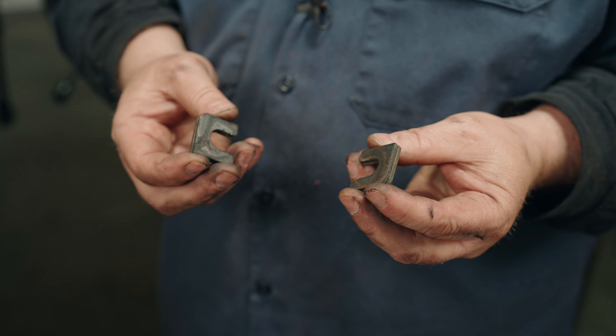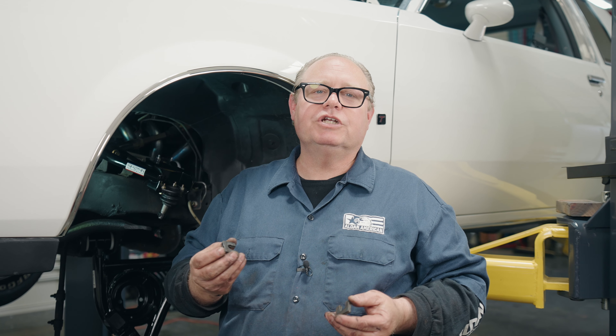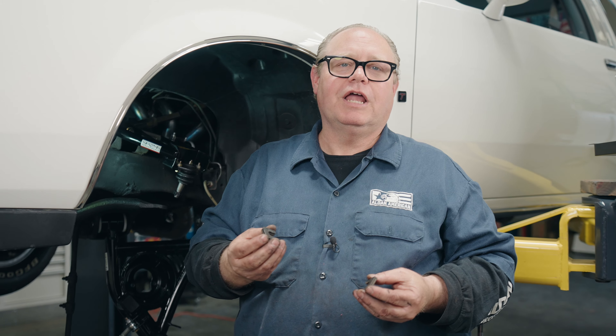When I took my original upper control arm off, I kept the original shims that came out. I know the car is going to need to be aligned and the alignment guy will most likely need additional shims. After putting the upper control arm on, I'm going to use the original shims and put them back in the same order they were removed from the original arms.